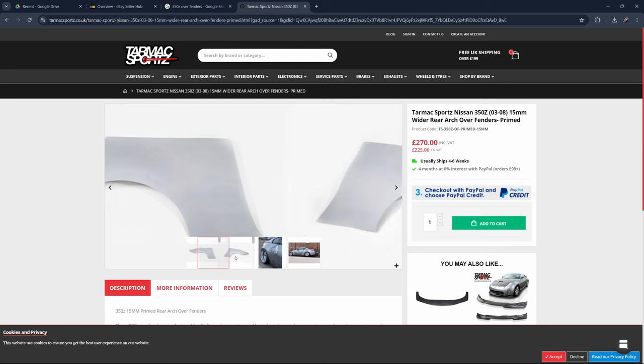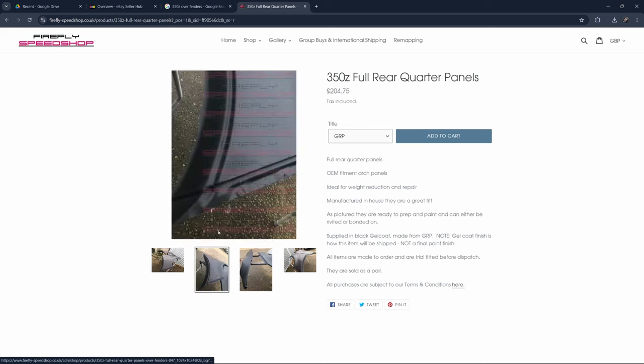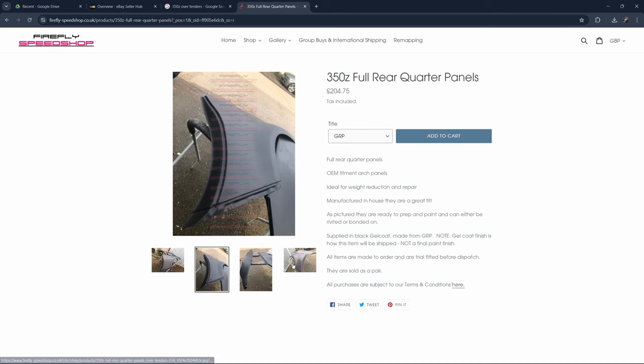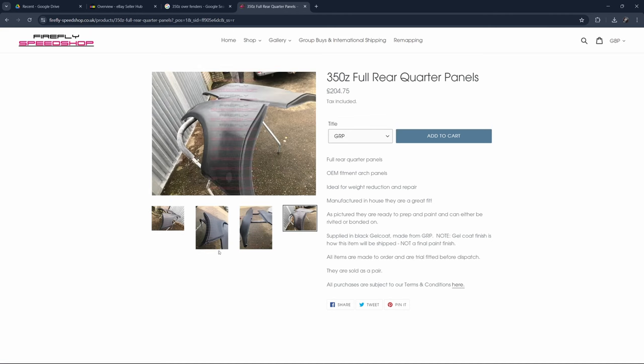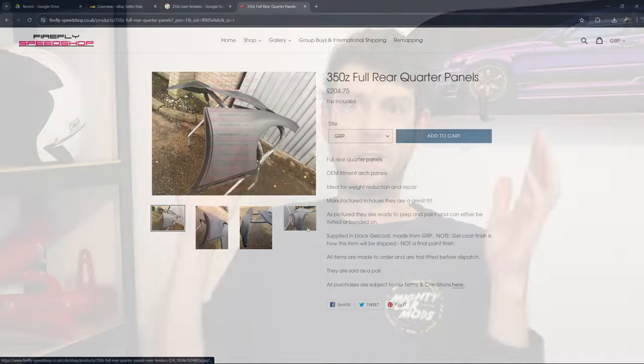The others are a little more expensive but very affordable and they're a lot closer to the original body line, only widening the car by 15mm which is really good. Then I found something from these guys - replacement panels that basically cover everything on the rear quarter, made of FRP plastic. You basically glue it on and what's good about these is you can actually create a weight saving, like with race cars. You chop all that metal area out you just don't need and just glue it on. In drifting that's actually a really good idea rather than sticking something on top of existing metal and making it bulky. These are only £200 for the pair - pretty sure you'll have to do some body work to make them look nice, but £200 is really good - £100 per side.